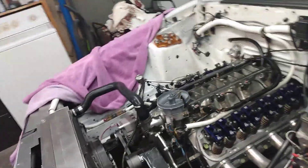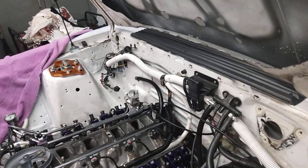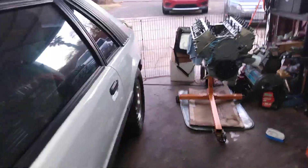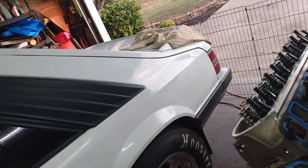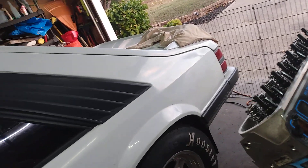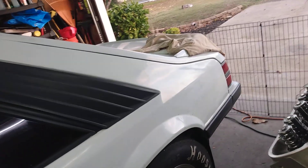After that, I'm getting pretty close to where we're going to have to put a six-point cage in the car and possibly a QuickTime SFI bellhousing. I'll probably switch over and put a spool in the back, and then put c-clip eliminators on there. I think with that I'll be covered safety-wise up to running nine seconds.